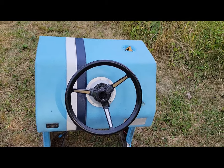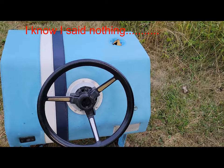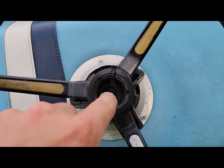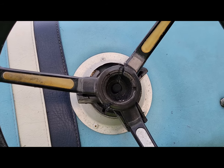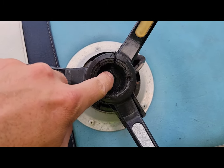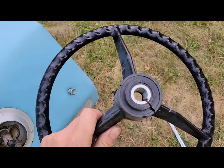One of the things we are keeping is the steering cable and the actual steering wheel hub. I had to get the steering wheel off. The problem is it has a nut and a washer, and then a keyway spline it slides over. But being there for like 30 years, it didn't want to come off. So I went ahead and took a Sawzall and cut straight through all the way down to the keyway, and it should come off now — and there it is.